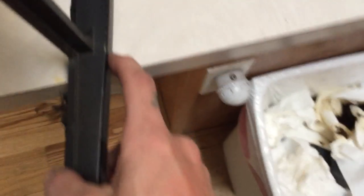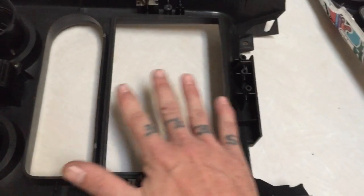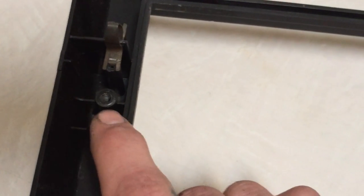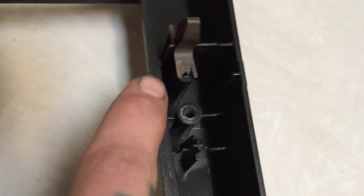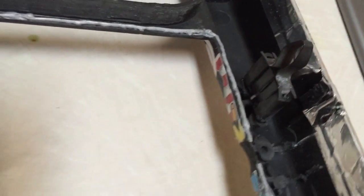Then you take a line and either mark it, or just take your Dremel or cutting wheel and cut down to here, then cut from here over to here. Now you end up with a totally flush section, and you cut back where your charging port is going to be, cut this one down because you don't need it, cut these fins back, and smooth these sides here just a little bit — because if you take off too much your iPad will be rattling around in there.